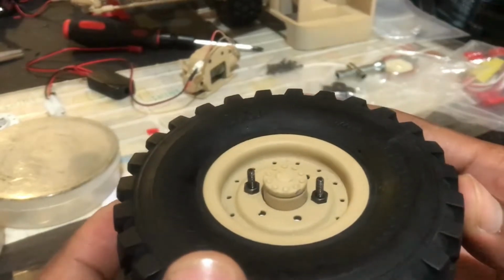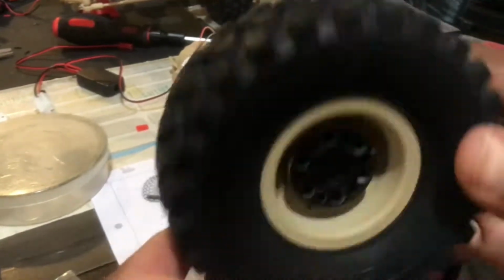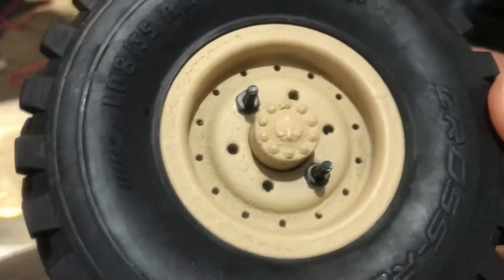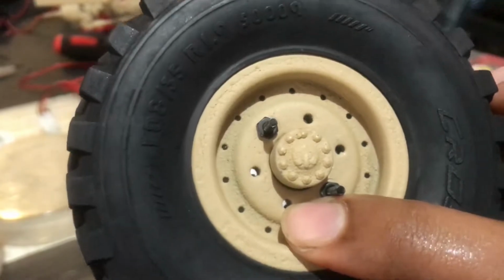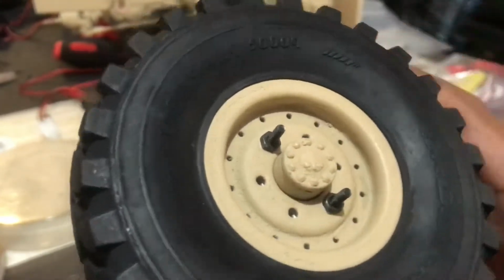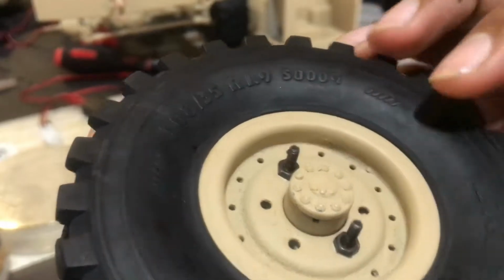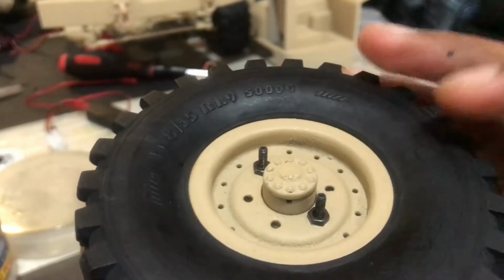So here are the 2 screws I mentioned earlier. Here you can see the length of it. So I mounted them in the back of the hub. Here they are, and if you look inside you can actually see the other beadlock ring closer than before. So I'm now going to proceed to mount the 4 short studs to clamp the rings further in place. Then we'll remove the 2 long studs and finish it off with the remaining 2.